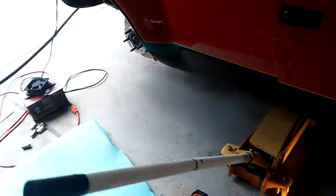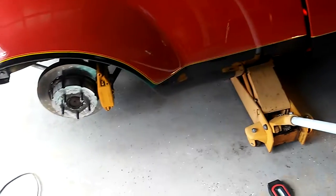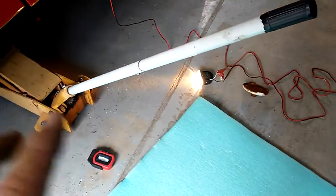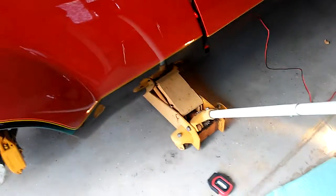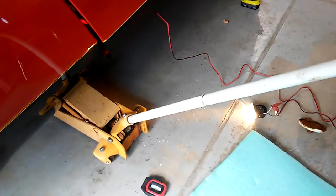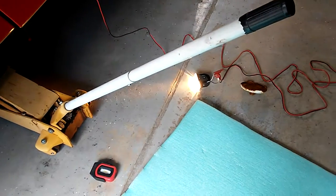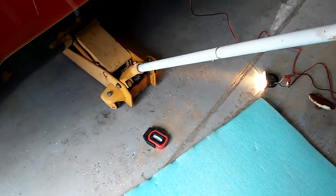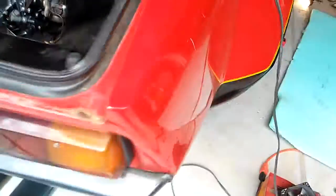That is the easiest way to diagnose a short circuit that is active. If you have an intermittent, you can do the same thing with a bulb — that's what I started out on. I had the bulb glowing dim, all the parking lights were working. I get in, start wiggling wires, banging on the car, and eventually it goes into direct short mode. But I didn't burn up any wires because I used this bulb as the load — it's just a fog light. So now the next thing I need to do is...